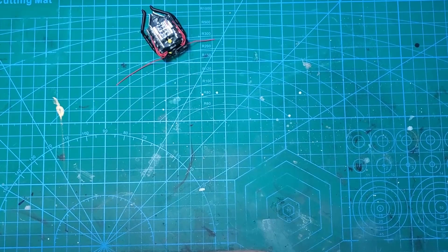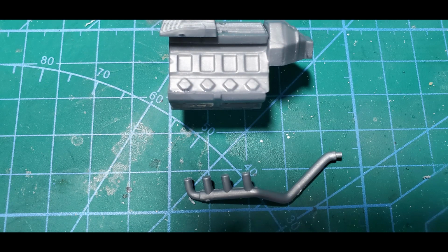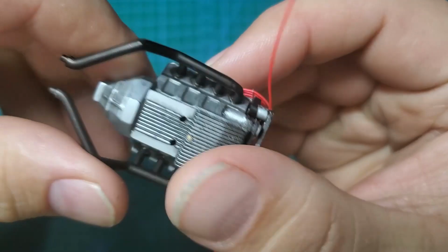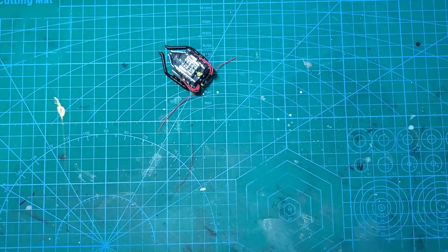The next issue to tackle were these exhaust manifolds. I noticed the pipes on the headers were smooth, and they flush mounted to the 4 diamond-shaped surfaces on the block, which, flush mounting with no location points, typically doesn't go well. They get knocked off and broken somewhere.